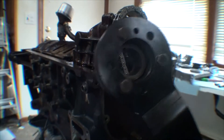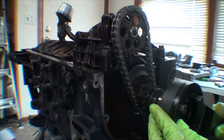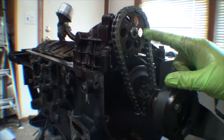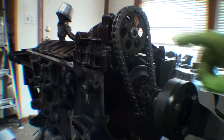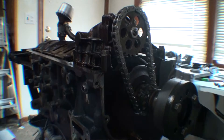I'm going to use the crankshaft counter-hold tool to hold the crankshaft while I torque the oil pump nut. Remember, it is left-hand thread, so your typical mechanical torque wrench is not going to be able to torque the nut. You'll need to use either an electronic torque wrench or find a mechanical wrench that can handle left-hand thread — there are some out there.